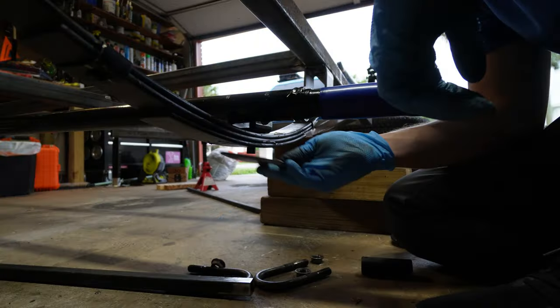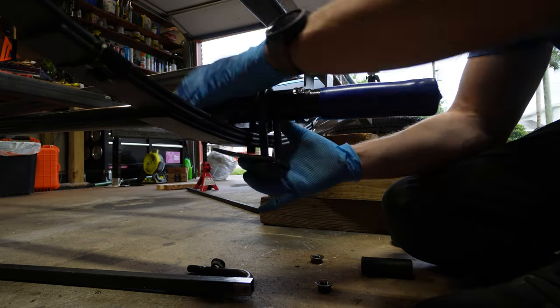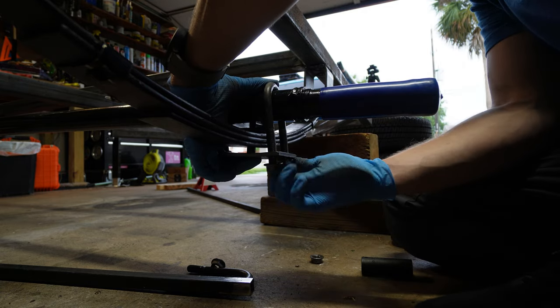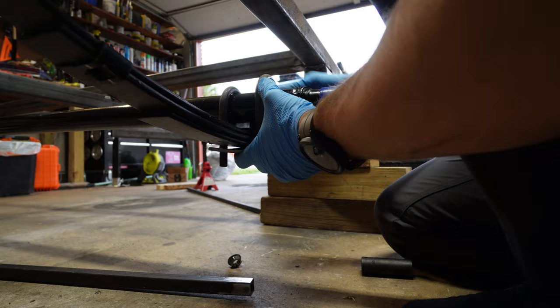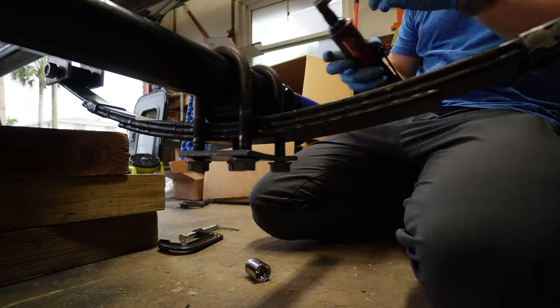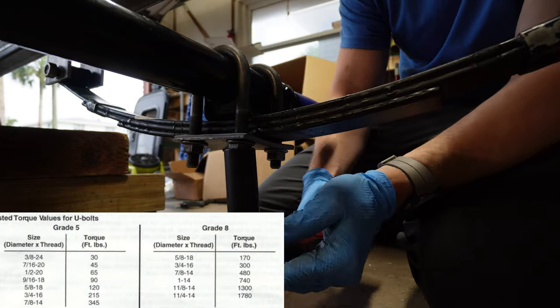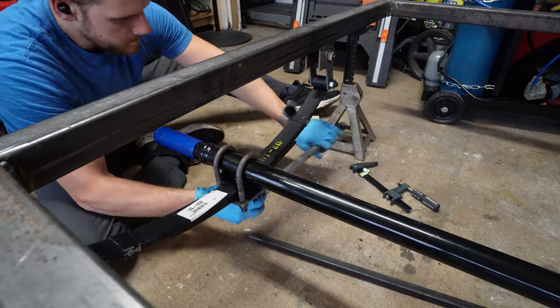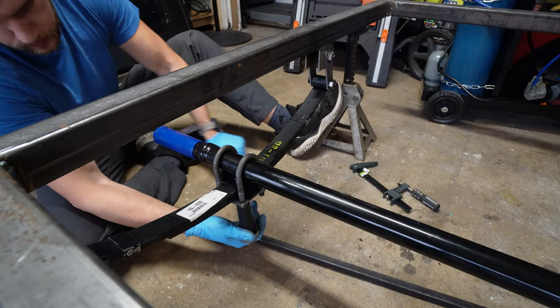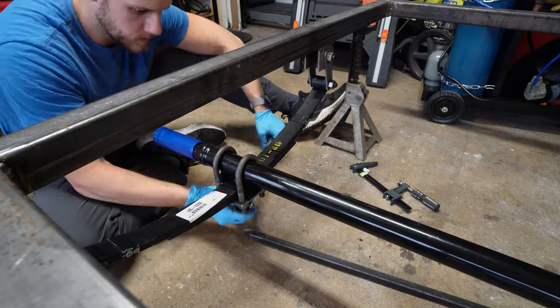They didn't have it in stock when I wanted to start this project. Once that's done, take your U-bolt kit and drop the U-bolts from the top to mount them to your bottom. Center your U-bolt on that stud on the bottom and then put your nuts on. You want to torque these roughly 45 to 55 foot-pounds depending on which kit you buy. 45 foot-pounds seemed to be enough — it was starting to bend my U-bolt plate, so I was content with 45.